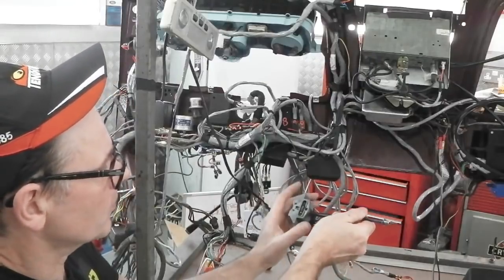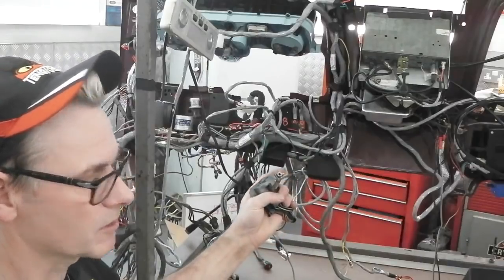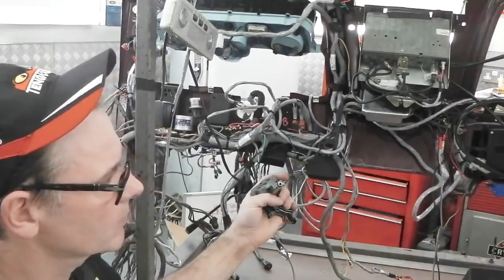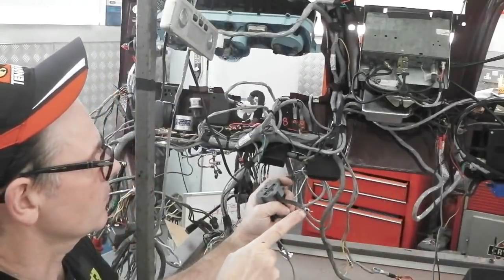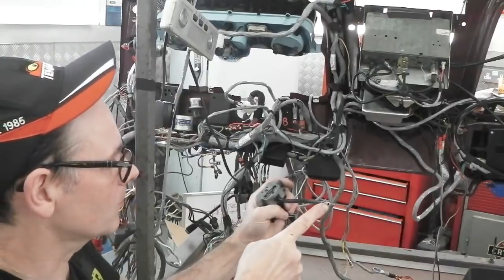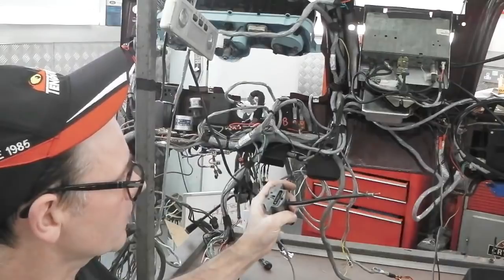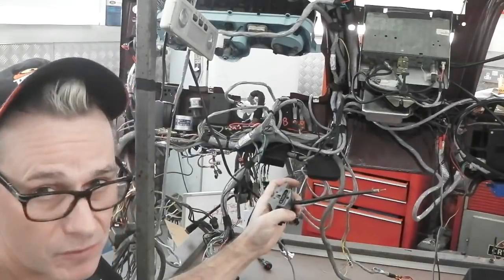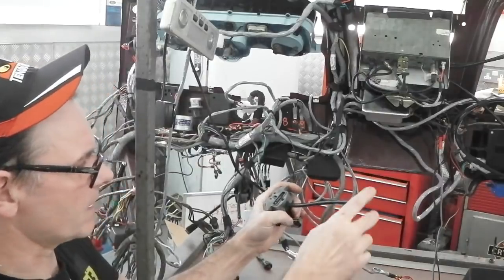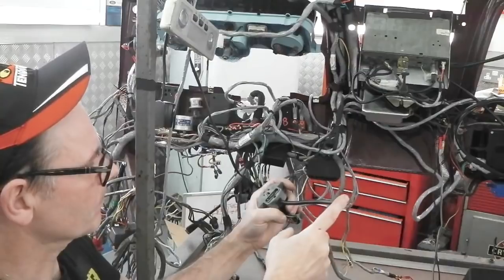We know that pulling up on the stalk gave us the intermittent. Simple timer, just a simple intermittent time delay, nothing special going on. It's all built into the box. We know that middle doesn't do anything. Down now will arm the auto rain sensing system if and only if we press the washer pedal. So you wouldn't accidentally arm it and have strange things going on that you don't want.